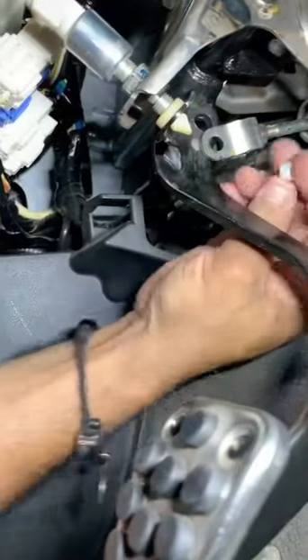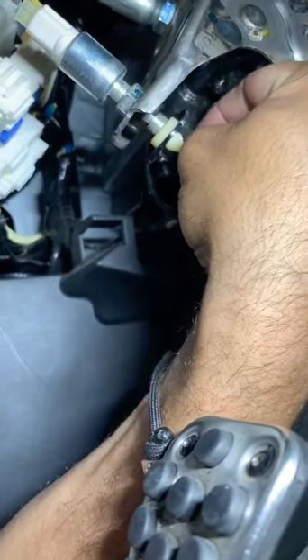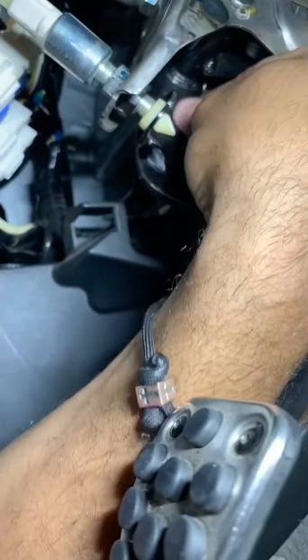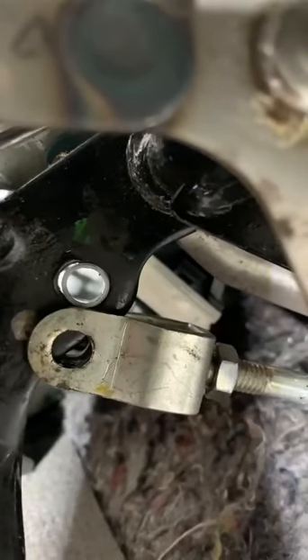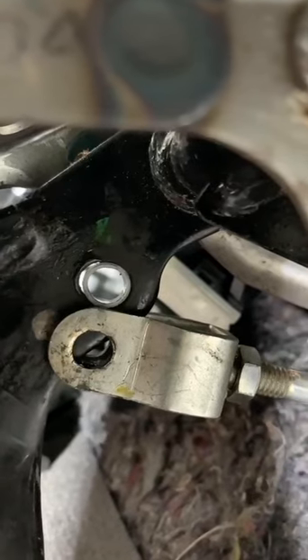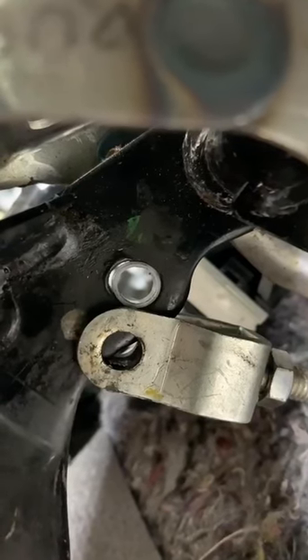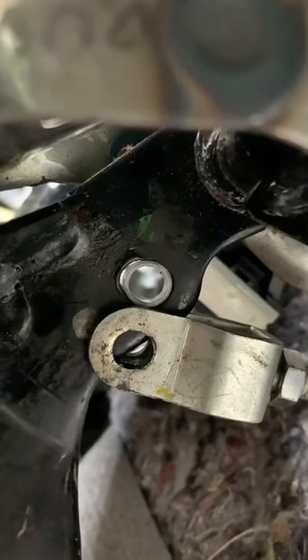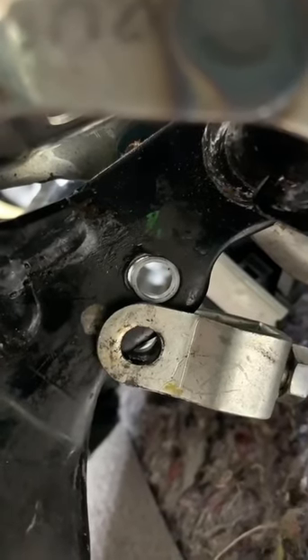It's very uncomfortable to install, but I'm going to put this on there and show you exactly what it looks like. You see that — now it has the bushing. If you notice on the side it has some wear; that's because this pedal has been using the pin without a bushing, so of course it's going to show some wear. You also get some squeaking — you can put grease and the grease will cut down on the noise, but eventually it'll come back. So now we're going to put back the pin.